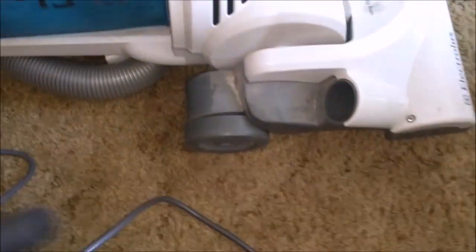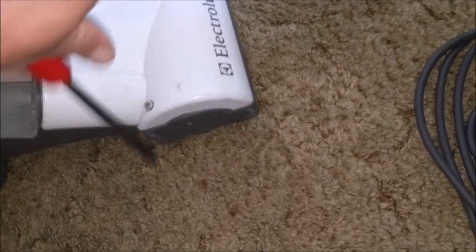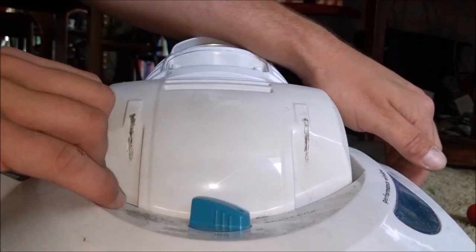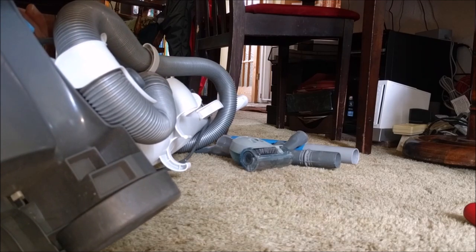Maybe we should do this properly - I'm going to take that out anyway because obviously where all the dirt goes through the rubbish filter and out, it can't escape the machine and blocks that up, which then kills the machine because it overheats and dies. If I just rip apart that bit of fabric it will blow rubbish out forever. So I think what we shall do - I need to be a bit careful with all these screws. We weren't fully expecting to do this but we'll do it anyway. These are Torx bits and I haven't got my toolbox with me.